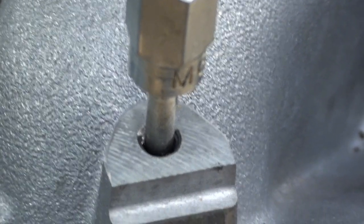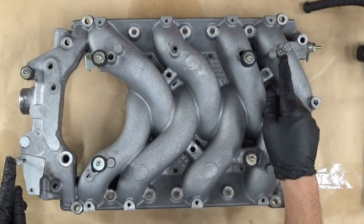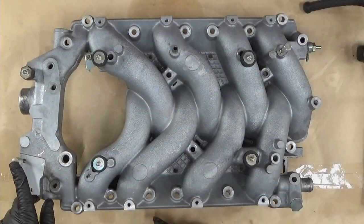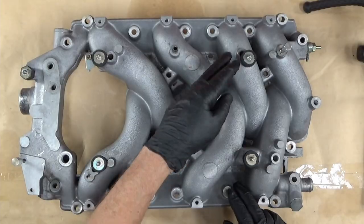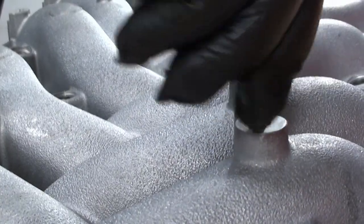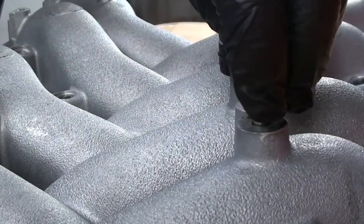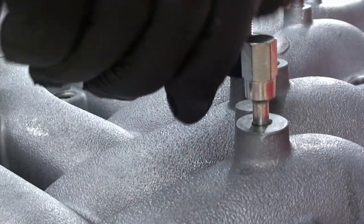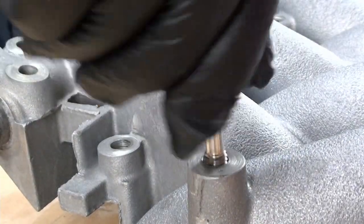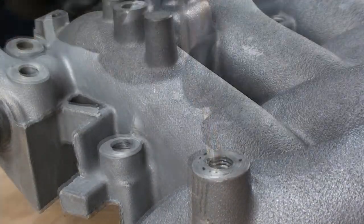Let's go ahead and chase all these holes — this is up here in the front, those on that side, and this one right here. I'll start with that one. This one here is pretty clean. Now if you notice, that went all the way through — so that's another one that goes into the intake that goes all the way through and should probably have some sealant put on there. Let's move to this next one — it didn't go in too bad, I'm surprised actually. I want to blow that out — you can see stuff coming out, but they're feeling much better now.